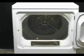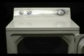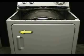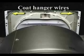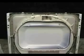Remove the top panel holding screws and remove the top panel. Remove the front panel holding screws and tape the door. Straighten out 2 wire coat hangers and use them to hold the front panel in place. I removed the drum to be able to show you how to replace the drum front bearing. But you don't have to remove your drum, okay? You're going to do the repair with the drum on.